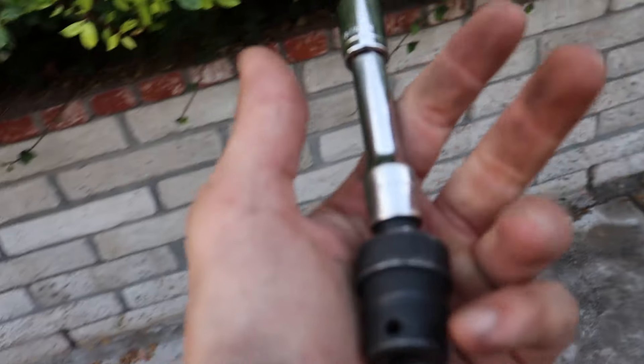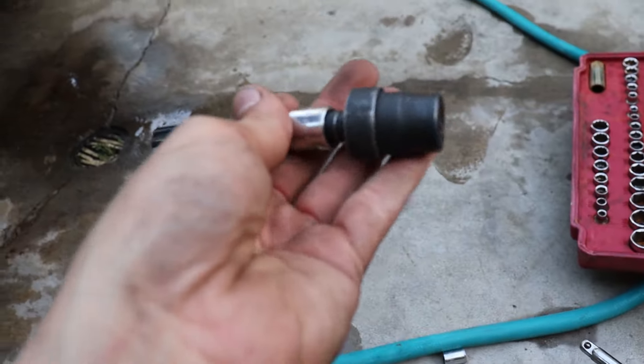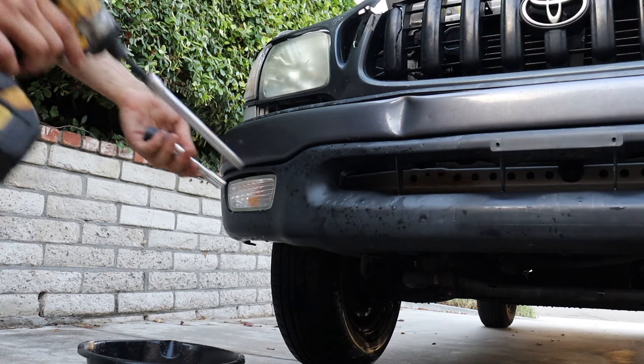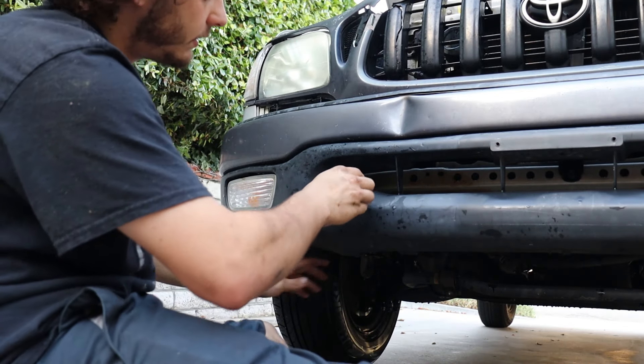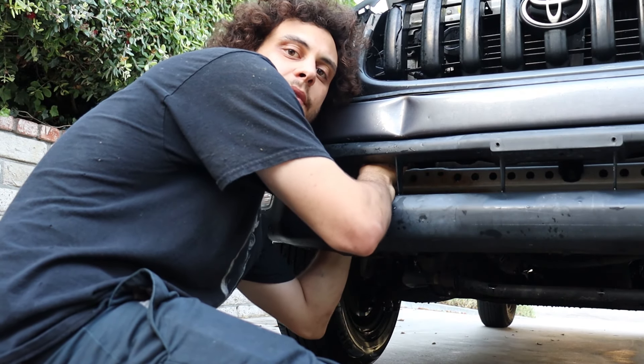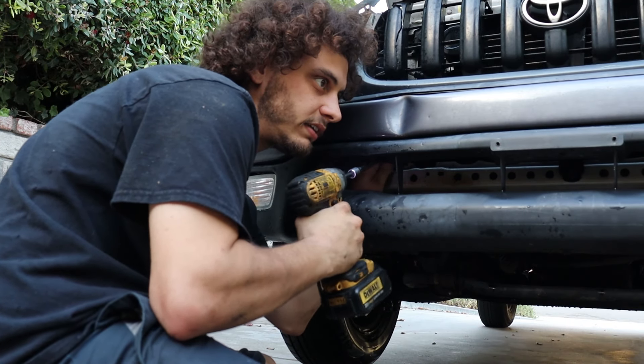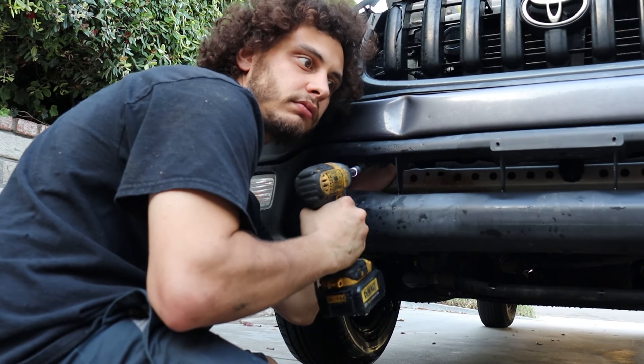Let's get those two lower bolts. So how we're going to do those lower bolts is with this longer extension, a wobbly, and this guy. You got to go up through here. That bolt right there at the top of that ridge is the lower bolt that holds the radiator in. We're going to get that guy out using this — I'll hold it up there with one hand and connect the wobbly to the impact. Got it.